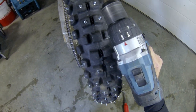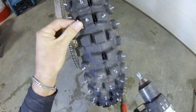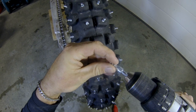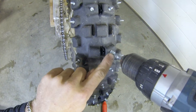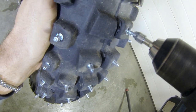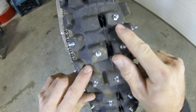Start off with your drill and make sure it's in the low speed setting — makes it easier not to over-strip your knobs. Here is the rear stud; you can see the big augers on there that dig into your tire. Insert that into the teeth of the install tool, stick it in the middle of your knob, and apply some decent pressure. Start off nice and slow and sink it in until the install tool is just below the surface of the tire.